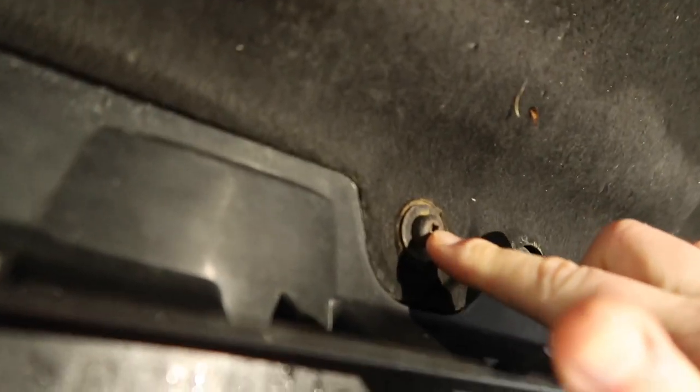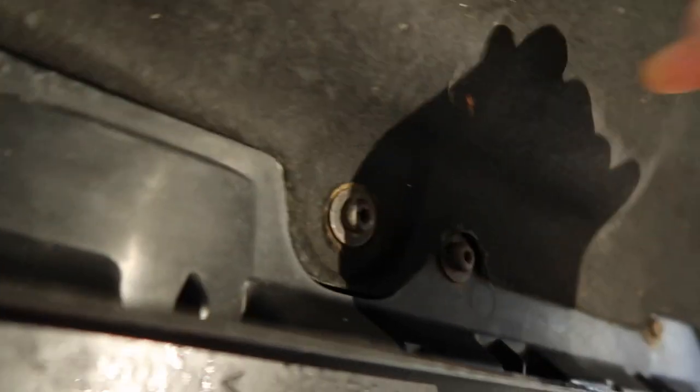Under the car, the brace is going to be going down sort of around there. It's going to start at the edge of the under tray, so it will be advantageous to get the under tray off at this point. I'm going to go around the edge with a T30 Torx to remove all the Torx screws. And then we just need a small flathead to pop off the little clips.